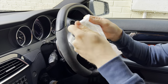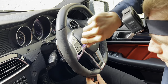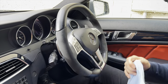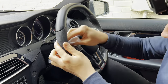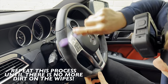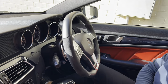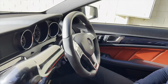So I'm going to clean up the other side now. First, get a baby wipe and wipe down the Alcantara to remove as much dirt as possible. While the steering wheel is damp, use the toothbrush to agitate all of the areas to bring up surface dirt, then rub it down with a microfiber cloth to remove as much dirt as possible. Repeat this process, and lastly use the hair dryer to dry off the Alcantara before using a toothbrush to fluff it up and give it that really soft, furry look.